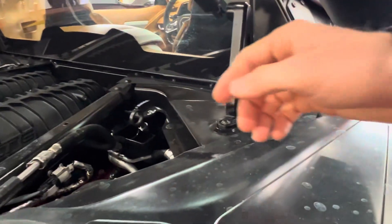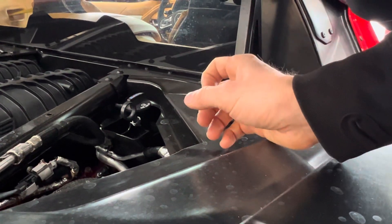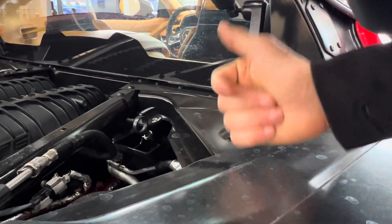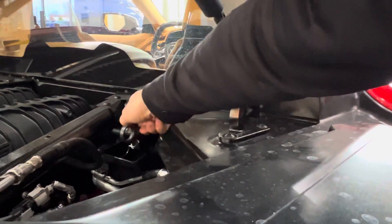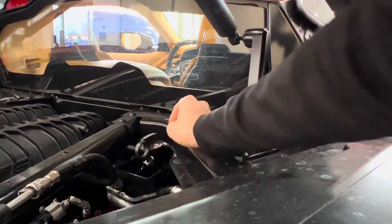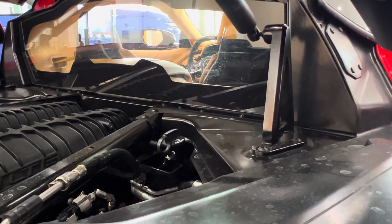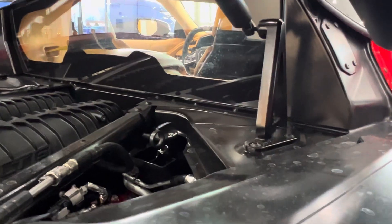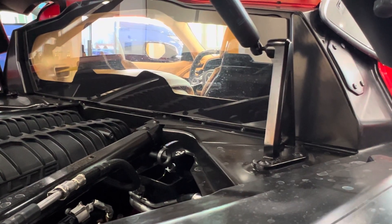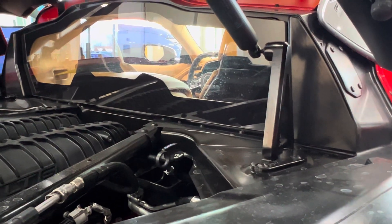What's the ball for? Normally, that ball is for when you flip something over upside down — it's there to catch it so there's not a problem. The C6s and C7s didn't have the ball because they have an airtight cap that screws on. So why on earth did General Motors put that ball on the C8 Z06? That ball prevents a customer and a technician from being able to stick a camera down into the oil tank to see that there is sludge in the bottom of the oil tank.